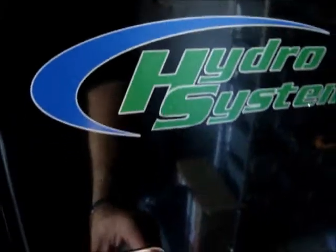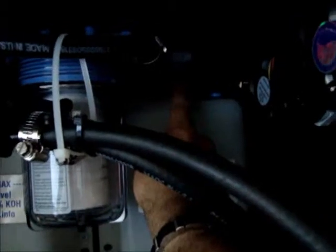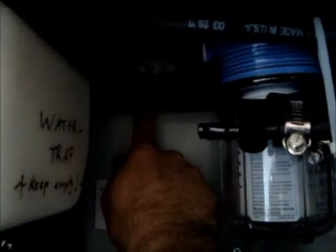Here one more time in short form — what to do to start up the system. You want to open the two bubblers. To do that, reach inside the unit, grab the white screw up there, and unscrew it first. Then on the other side, so that you can take out the plugs — first take out the white plugs. When those are out, you will be able to open the lids of the bubblers. When you open the lids, there is a hole in the roof where you can put a funnel to pour the solution into the bubblers.